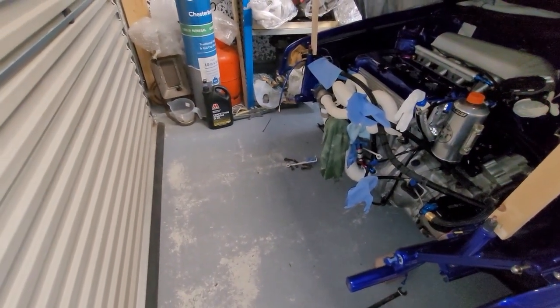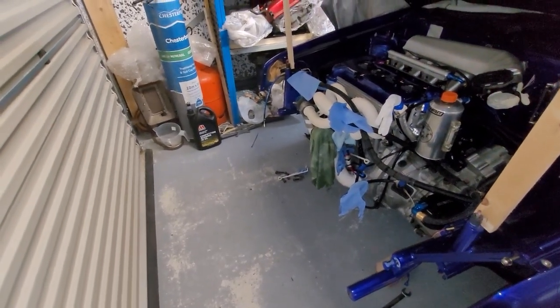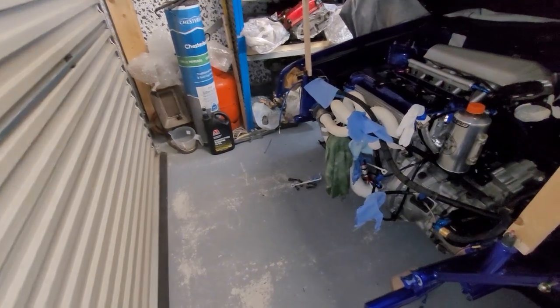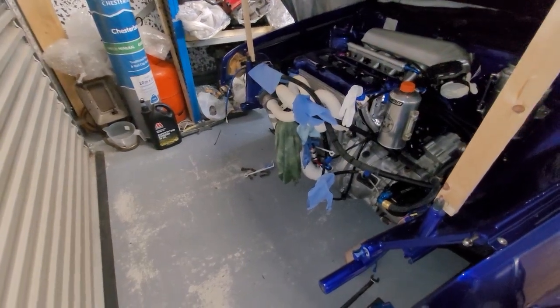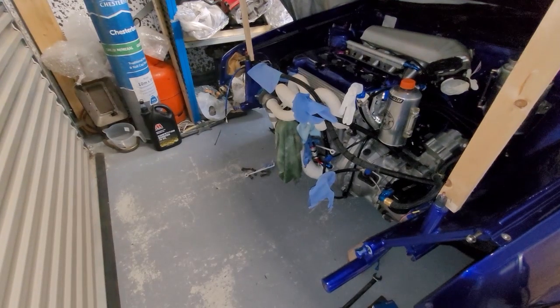Right, I've got the engine back in. I'll stick up a picture of the way I fixed the leak at the back. Teeny pipe boot, hand filed 2 grooves for O-rings, took me about 3/4 of a day. Put it in, plus sealed it back in, pressure tested it, and it seems to be fine.